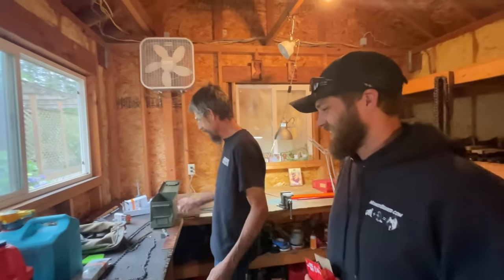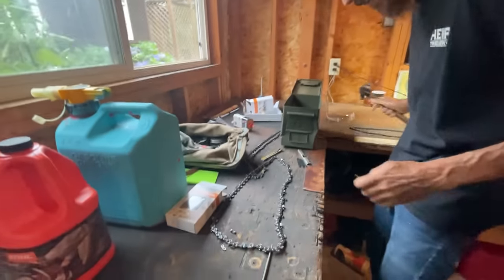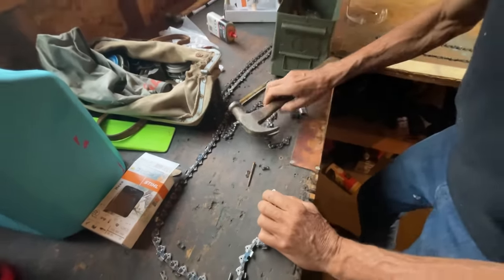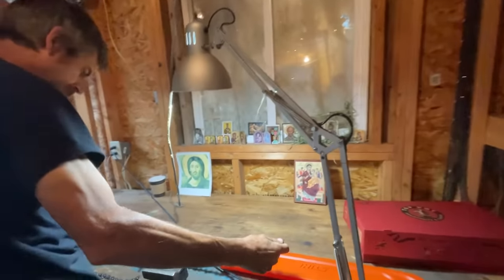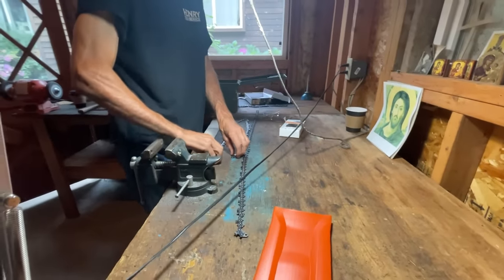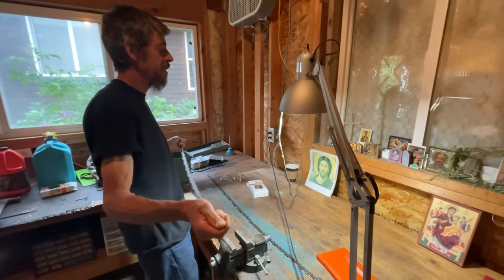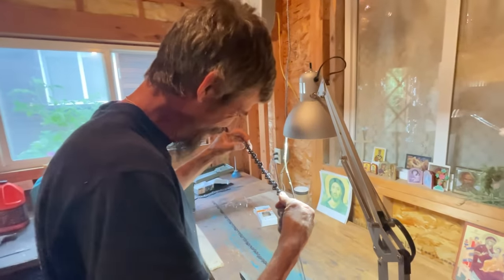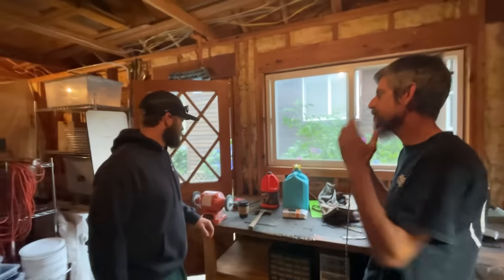We try to do the math: 60 plus 60 is 120, and 120 minus 15 is 105. So we need to count off and remove 15 drive links from the combined chain. We count through twice to make sure we get it right — one too many and you can't tension the chain correctly.